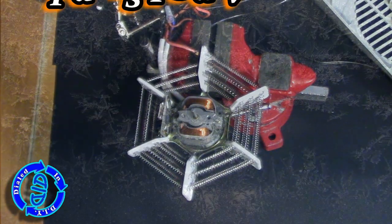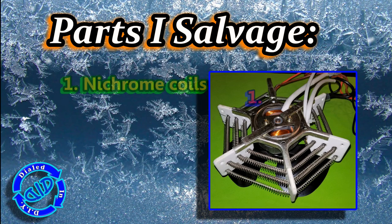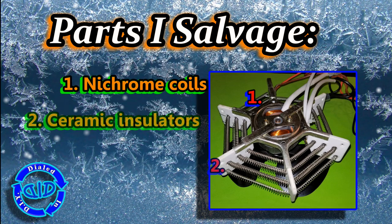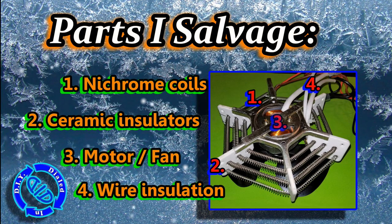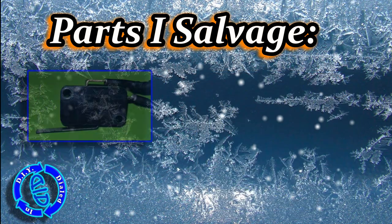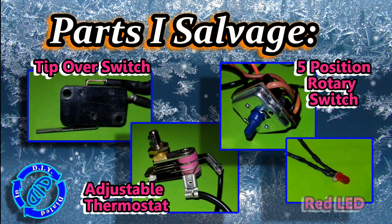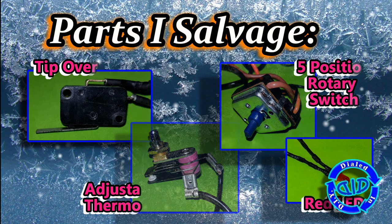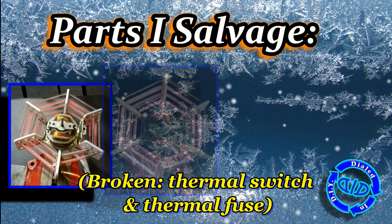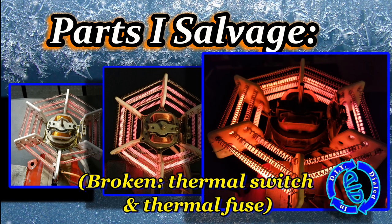The fact that everything works well is great news for me because that means there are parts I can salvage for other projects. I mentioned earlier that I love the nichrome wire for some specific projects. By cutting free some smaller sections of coils, I can make smaller heating units. I can also take out a longer piece, stretch it out, attach it to a handle, and use it for a wire-based foam cutter. You can also use a small section of the wire as a filament to make a small homemade lamp. Because of the two small broken parts, I'm turning this from a repair project into a salvage project, but just looking at these coils tells you there's some serious fun you can have making other projects with these parts.